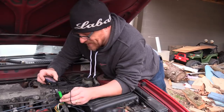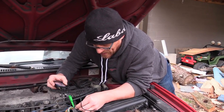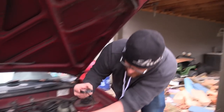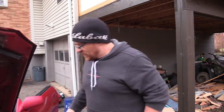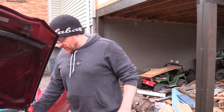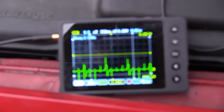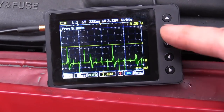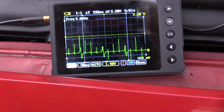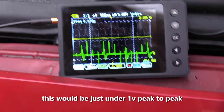The noise is a byproduct, but doing anything with an internal capacitor is not going to help us. The only thing I could maybe try to do is bend the pickup closer. You know, the noise is just what it is. Let me get a before and after — before I try to adjust the air gap. I'm on a half a volt per division right now, and I want to see what it looks like with this capacitor on here to see if we drop the amplitude of the sine wave.